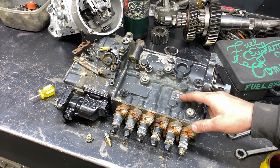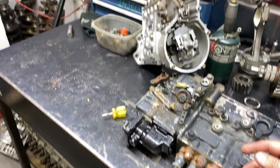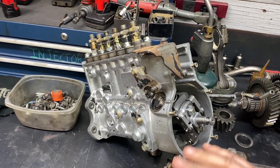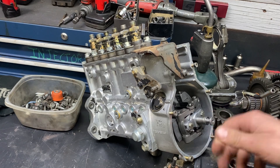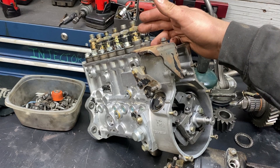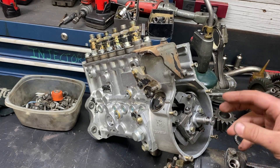The problem is, if you have a pump that's set up differently with a different pump cam or being modified, then the numbers can be a little bit off. This was the case with my Scheid Lightning 13MP pump, where I didn't really know what the pin timing was set to. So the last method — which was actually my first time trying it and I'm a believer it's the best method — is doing the spill port timing method.